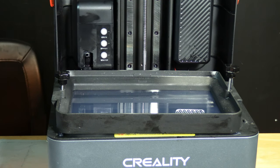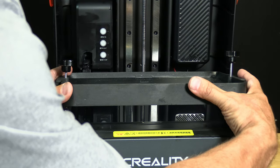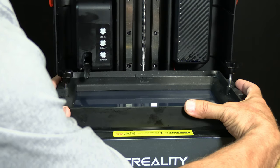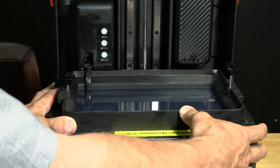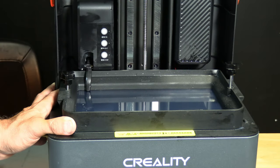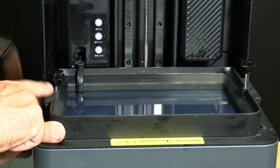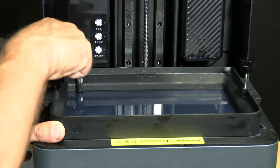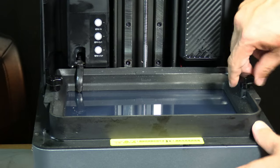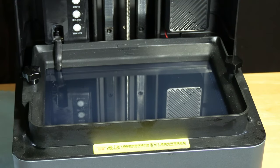You are going to see it doesn't go all the way in — that's because you have to lower your resin fill nozzle. Tilt the bed up a little bit, get a little pressure on the lever under the nozzle, push that down, and the nozzle will start to move. Continue working the nozzle until it comes down more, then place the bed down and push it in the rest of the way until the nozzle snaps into place. When you first do this a time or two, the nozzle and its mechanism will be a little tight — after doing it a few times it'll become much easier. Line up the screws in the printer with the screws in the vat and tighten it down. And there it is — your beautiful new Halo Mage Pro resin release film and vat, ready for use.